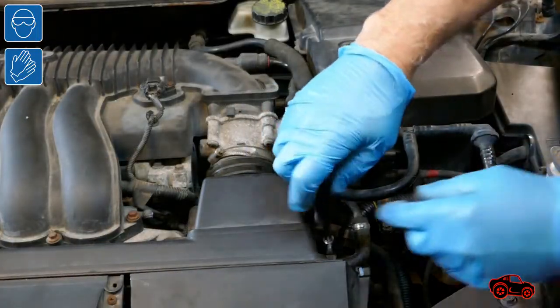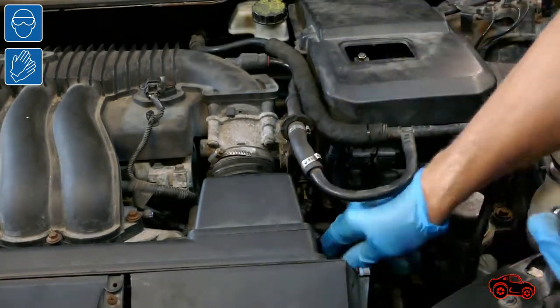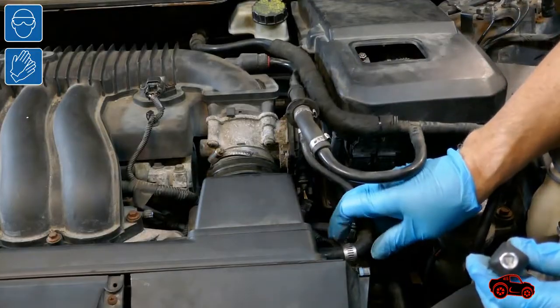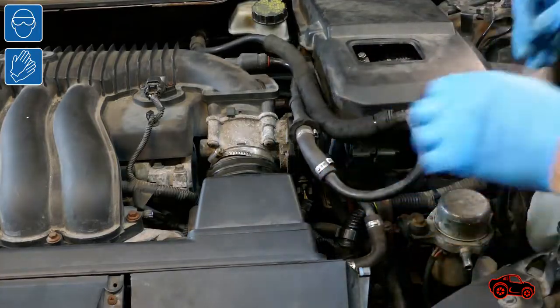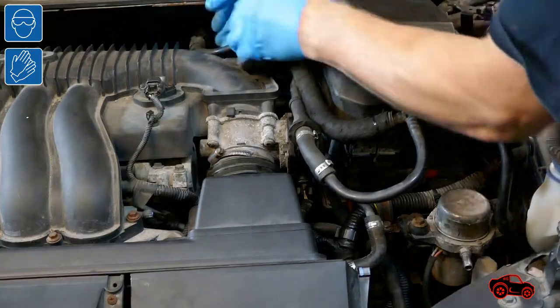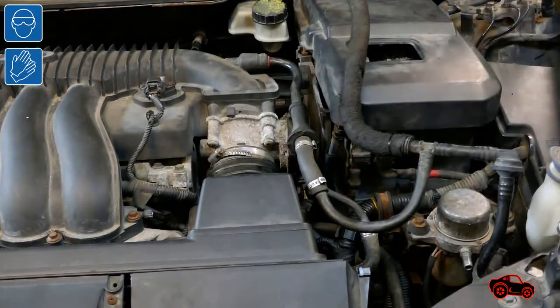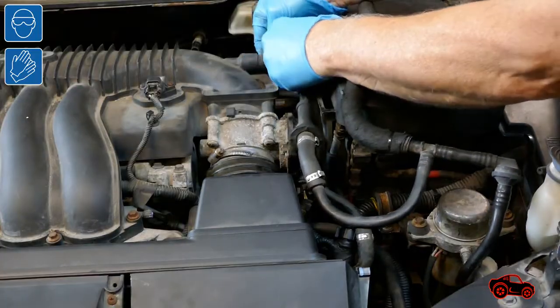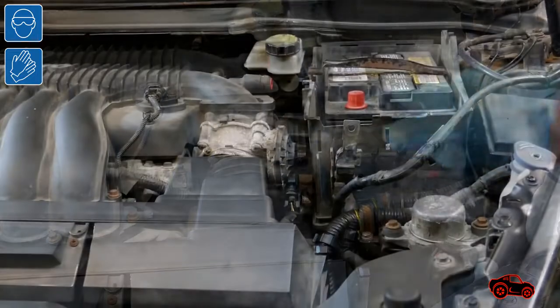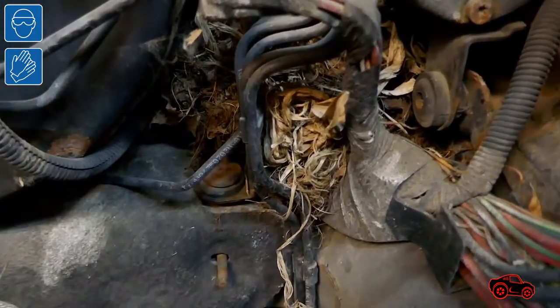In order to adjust and lock the two camshafts properly, many components had to be removed: the rubber hose from the air cleaner assembly, the vacuum pump quick connect plug, the vacuum brake booster quick connect plug, and the upper intake manifold quick connect plug. It was not required to remove the battery and the tray, but it made it easier to work and film. In this case, it gave me the chance to find and remove a rodent nest.